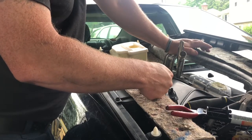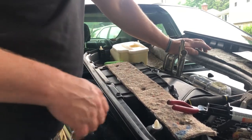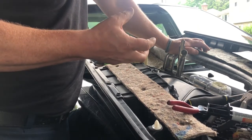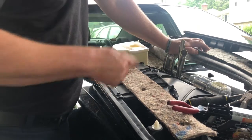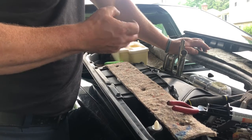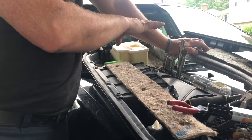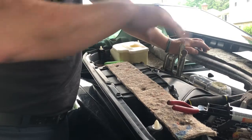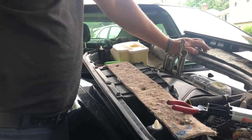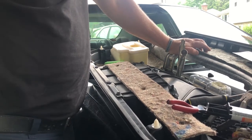So you want to make sure that it's in a position where you can just leave it, whether that's putting weight on it to make sure it stays in place, or clamping it down using a C-clamp or something else that keeps these things together. You can see I did use a set of channel locks, vice grips, I'm sorry, on here to keep the pieces together that I'm trying to plastic weld. Because I don't have that ability in the position that this is in on top of the car and the door trim, I'm just going to have to keep some pressure on it for quite a while. It does set in about 5 minutes, so I just have to keep pressure on it till it starts to set.